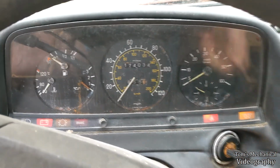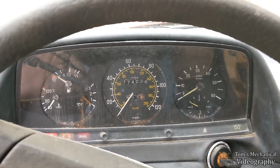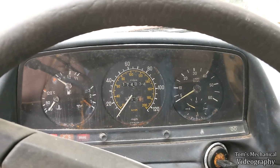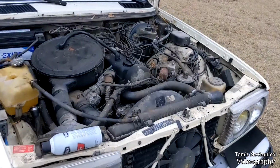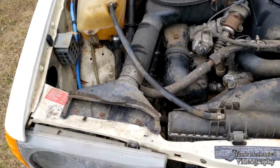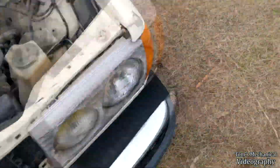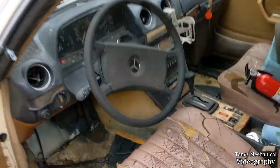Shit. Alright. Another 4 more glow plug cycles, I guess. I'm gonna go check and make sure the fuel system's primed. Stand by again. That's 9, and I'm gonna give her a snort of ether immediately beforehand. And the fuel system was primed. It's holding prime a lot better with the strainer cleaned. Now we're going to see if she'll fire.